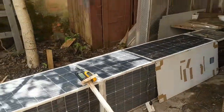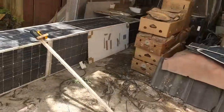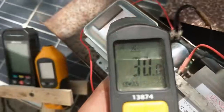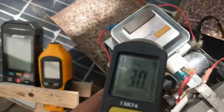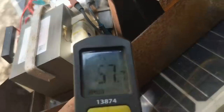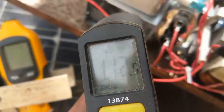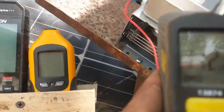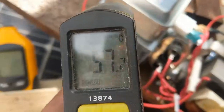I did hear some clicking noise. And you see I don't really have to go there - I can pull the plug here. Okay it's 55 here, and the transformer is 56, 58, 60. That's well below critical. That's 107 degrees - so indeed you see the magnetron is getting the hottest.